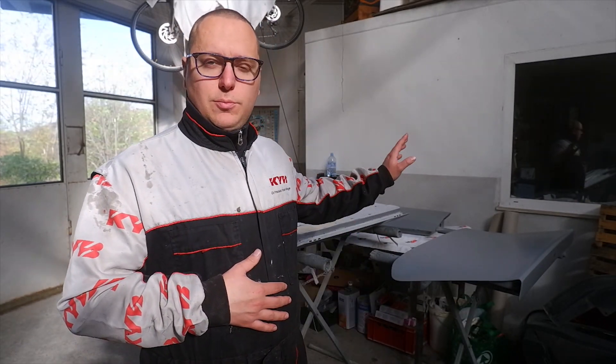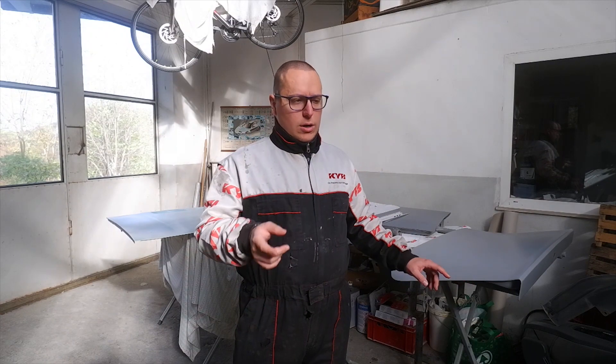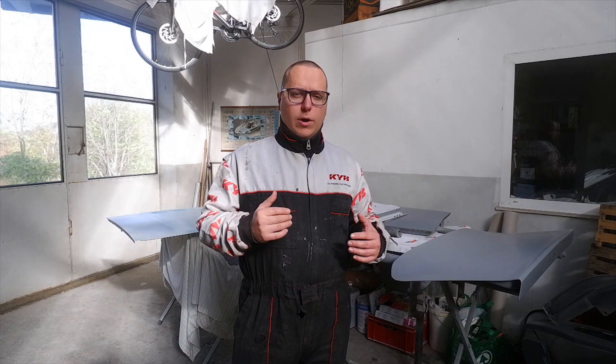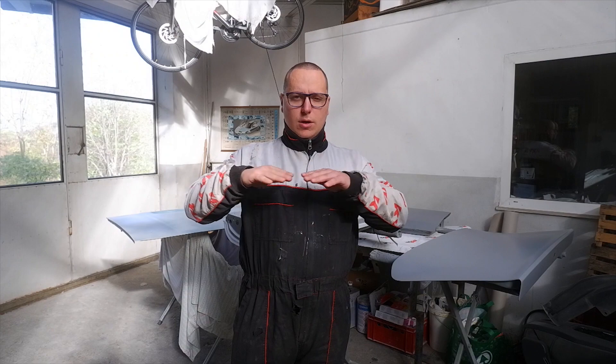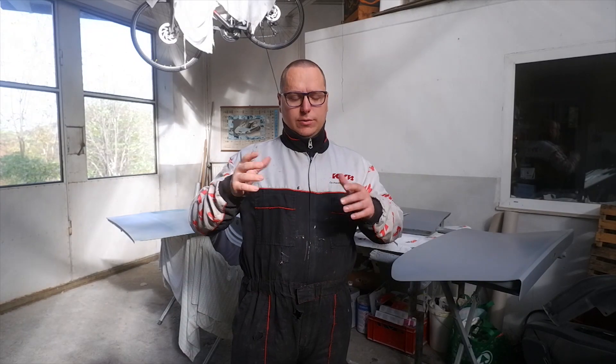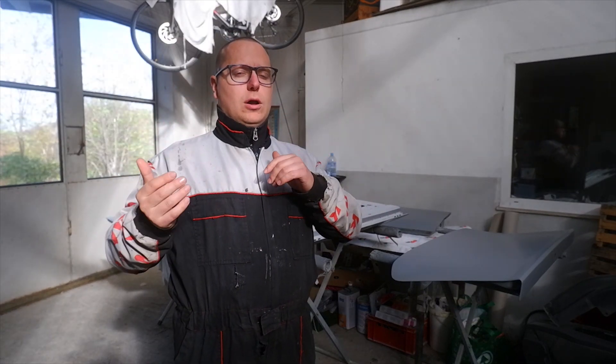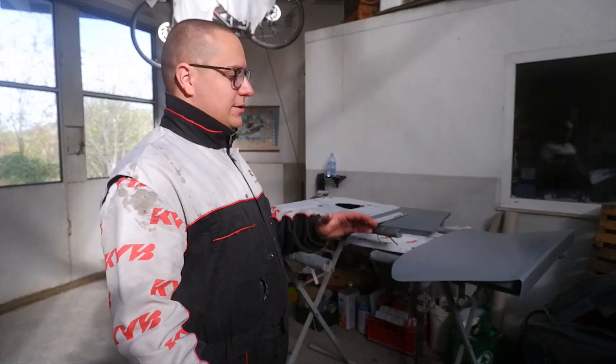The plan of attack today is to get these parts out, protect the insides from rusting, and put the surfacer on. We have a gray surfacer here — you also have a white one, but the gray one is nice because when you're sanding it, it turns white so you can see the highs and low spots. Be mindful of which color goes on top: if you're painting the car white, it's nice to have a white surfacer, because gray under white creates a lot of contrast and makes it hard to cover. And if you're painting the car black, don't go with white surfacer.